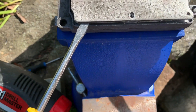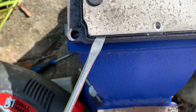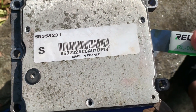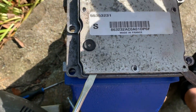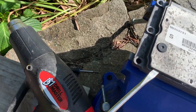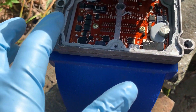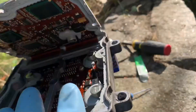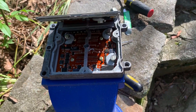Once you get to the point where the front is sort of open, you're basically done. Don't stick the screwdrivers in too far because there are circuit boards on the back side. You want to run the pry tool along the outside without going in too far to break that seal, so you can get this lifted all at the same time. Let it cool once you've cut around the outside, then lift it open far enough to work on the chip — but don't bend it back flat. There is stuff on this side, so keep the screwdriver shallow.